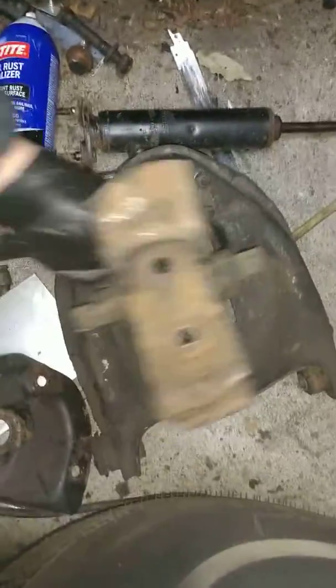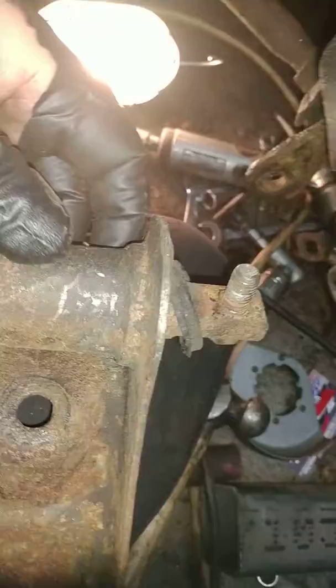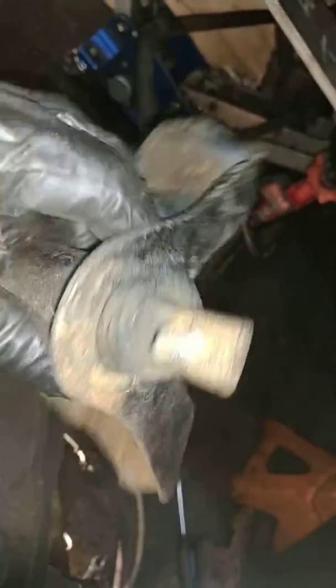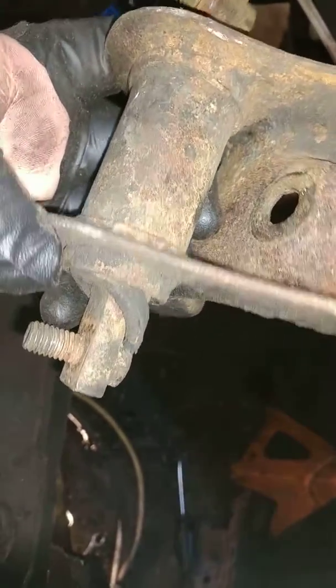This is the spring perch — those two bolts go in there and it's completely gone. It doesn't really have any play but a nice chunk is missing. It's probably dry rotted, could probably squeak and make noise. A lot of these cars are not driven for a long time. But you start driving it every day for six months and all of a sudden all these bushings really start to go. The replacement piece I got was only $15.99 plus tax.